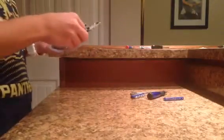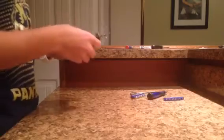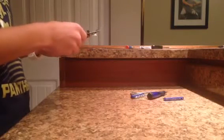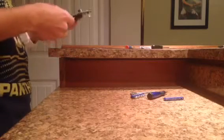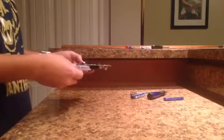Alright, after you put that in, put your D-pad back in. It goes in pretty much any way. I'm not sure there is a specified way. I know the rubber needs to go on a specified way because there's always little hooks that hook into place. Make sure you kind of mash your rubber so that it's going back into the D button, because if you remember, it was kind of stuck together.